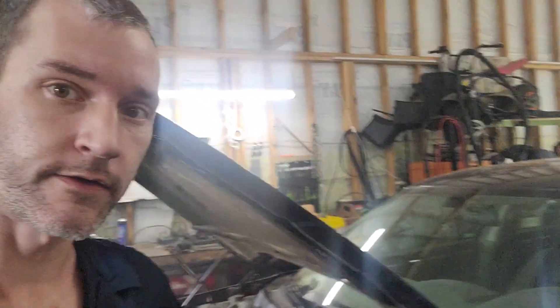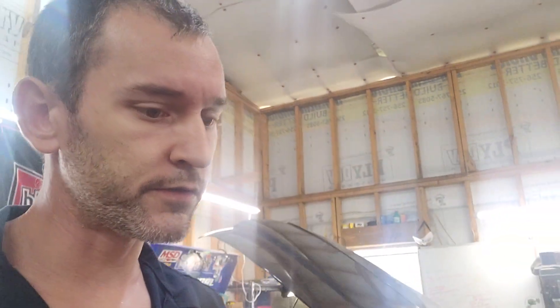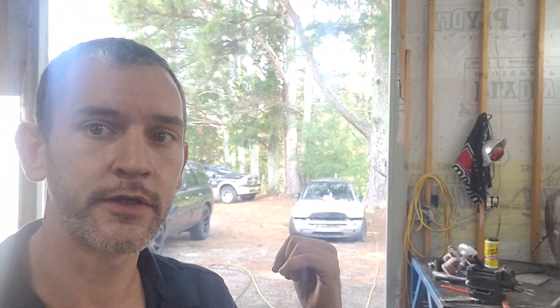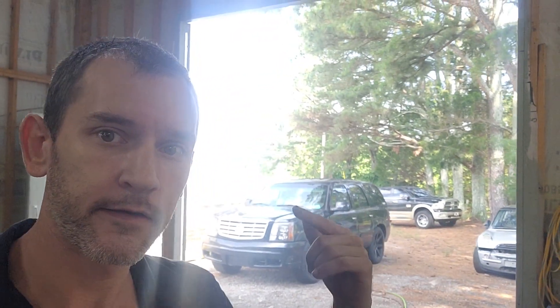So I was a little worried cranking it up this morning, but it's done and it sounds good. I didn't have any codes — well, I did have some codes because I cranked it up with some vacuum leaks. These two little hoses on the back behind the throttle body I didn't hook up, but I hooked those up and cleared the codes. No codes now, so we're gonna send this sucker out the door and get on to the next one.